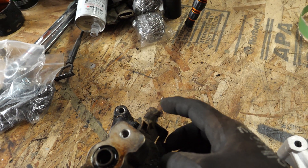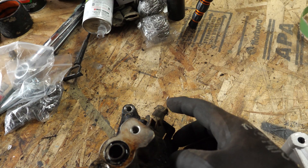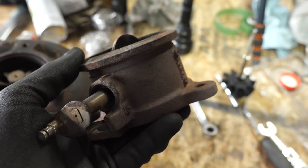For the actual electronic piece, I do have a 470 ohm one-watt resistor coming from Amazon. We're going to get that put in so the computer doesn't care that the EPV valve is no longer plugged in.